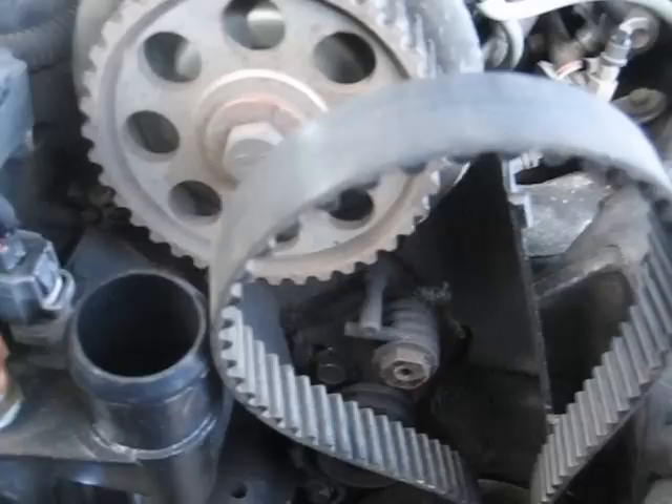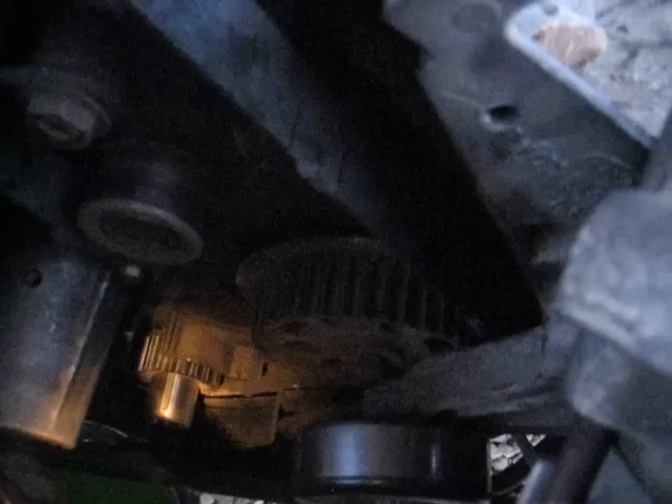You just got to go through and put your new belt on. One thing you might want to do is that keyway needs to be sitting straight up. One thing I mentioned earlier was the need for leaving the harmonic balancer on - you cannot do this with the harmonic balancer still on. The repair manual doesn't specify, but I am telling you from personal experience that that harmonic balancer must come off, because otherwise you can't get the belt off the bottom sprocket.